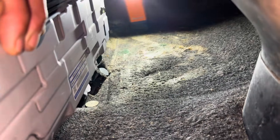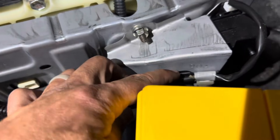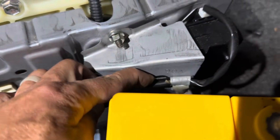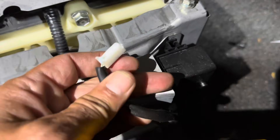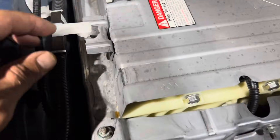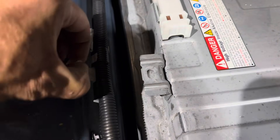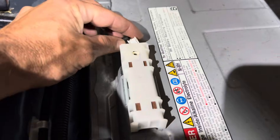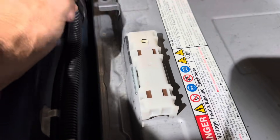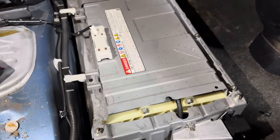There's also a clip on the other side. Go ahead and disconnect the quick connect — it pushes in and there's a clip you can use trim pullers to pop out. There are two connectors that pinch in from the top and bottom; reach your hand in and pinch each side to pop them out. And the last one — push in the top and pull it out. Once you have this harness disconnected, go ahead and put it safely to the side. Now we're ready to move on to the other side.